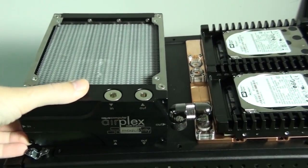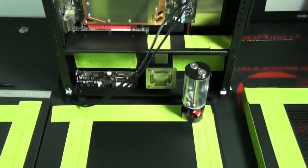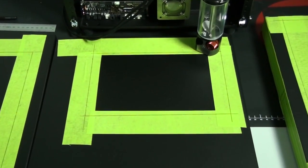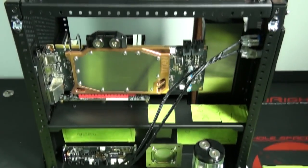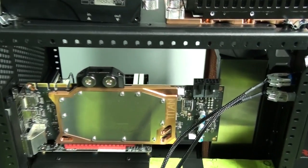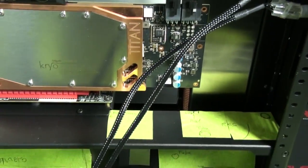The tubing routing is the most difficult part because, for example, the reservoir, the filter, and the pump are going to be millimeters apart. And when components are that close together, often there are no fittings that will actually get you between those components.